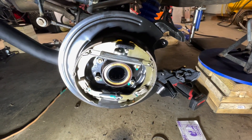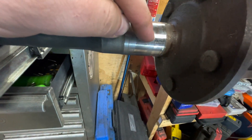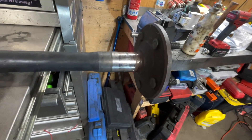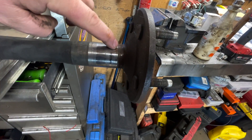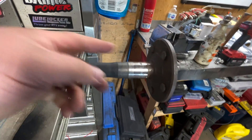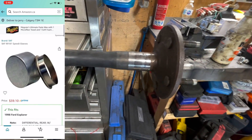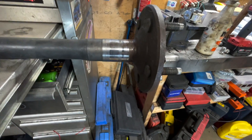The second thing is the axle shaft itself. You can see my axle shaft right here — that's where the seal groove is, or where the seal rides. Over time, the seal can rub a wear mark into the shaft. If you get a groove worn into your axle shaft causing a leak, don't be alarmed — you can get a speedy sleeve for that, which will correct the problem, at least short term.